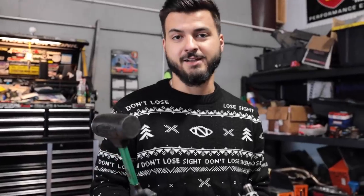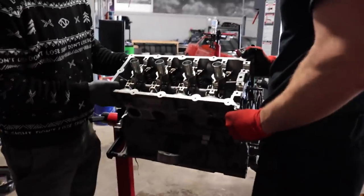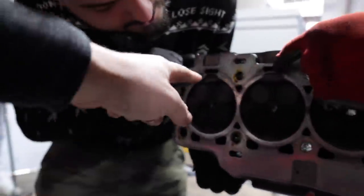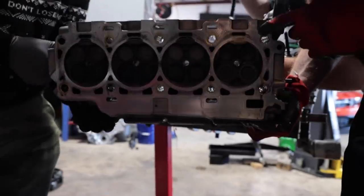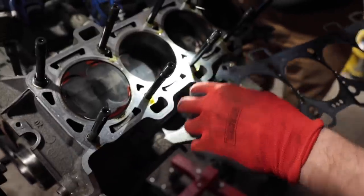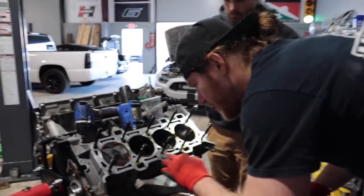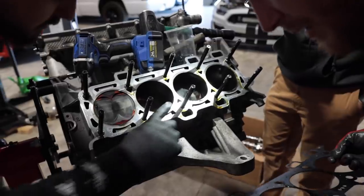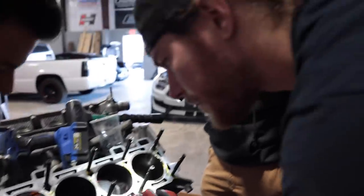Timing set is out of the way, head bolts are completely loose. With our SK mallet we're going to pull this head off and see if this is where the issue is. Not this one — but those pistons look good. There it is — look right here. One, two, three — three cylinders. You can see it burnt through right here. One's not as bad, but underneath you can see it's pushing through. This one was definitely burnt. They all look like they aren't sealing perfectly on this side — you're seeing exhaust chamber gas right there. This one's extremely bad. Well, there we go — it's definitely obvious we had a head gasket failure.